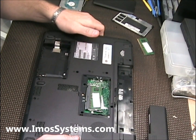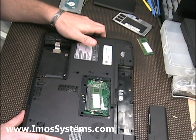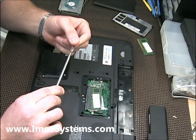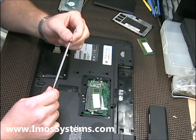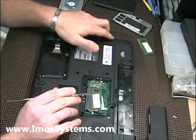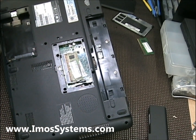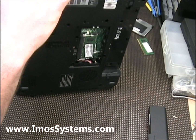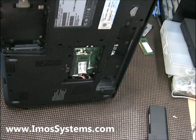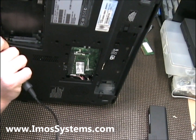So we've got our laptop. What you're going to want to do is get a flat head screwdriver or a piece of wire — I'm going to be using the flat end of a spudger so I can just touch the two pins together. You want to probably put the laptop up on its side like so, and you want to plug in your power cable because you're going to need power to flash the BIOS password.